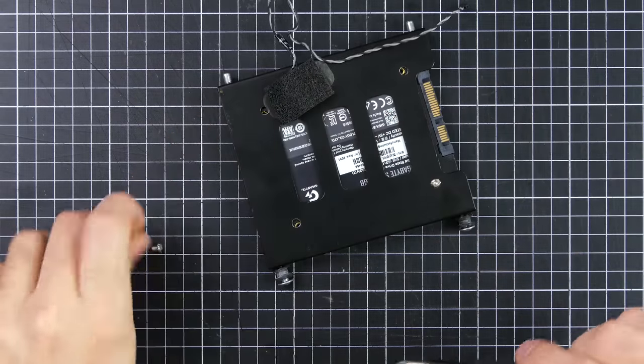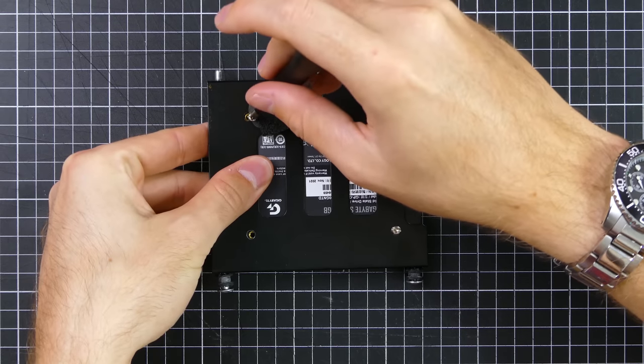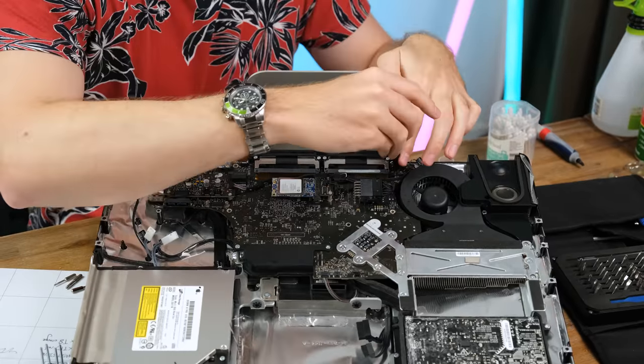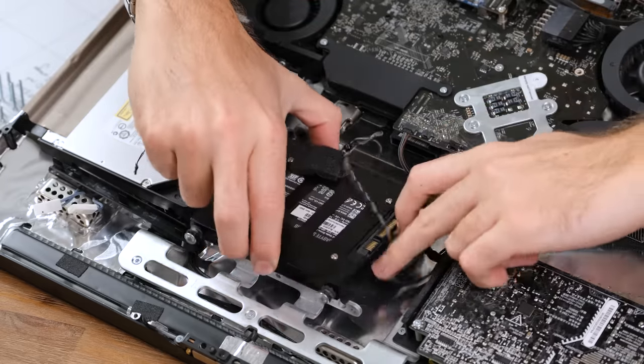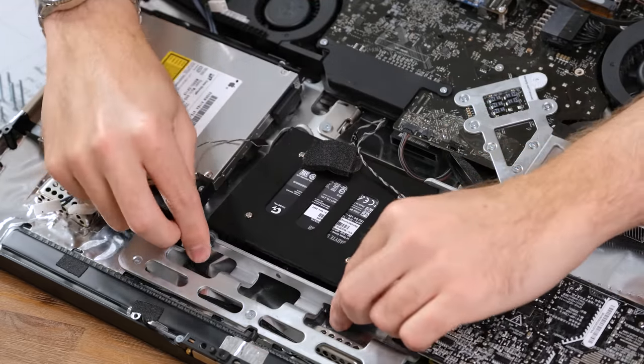The old SSD is fine, however, for privacy reasons, I'd prefer to simply put in a new drive as I'll be auctioning off this for charity. You'd be surprised how much faster an old Mac can be with the use of solid-state memory. A secondary 2.5-inch SSD can be put in place of the optical drive. However, in my opinion, it's still quite useful being able to read and write CDs.